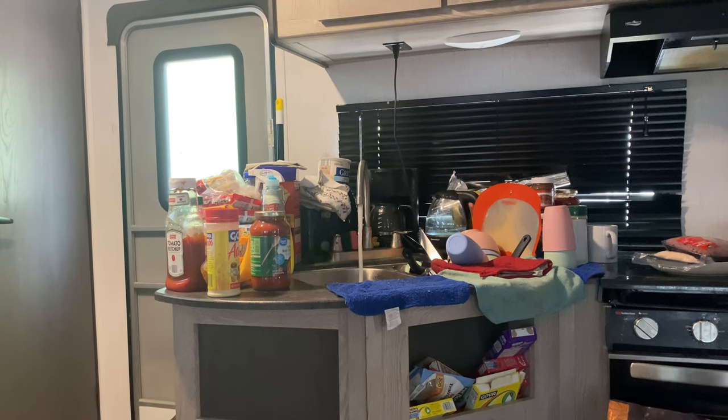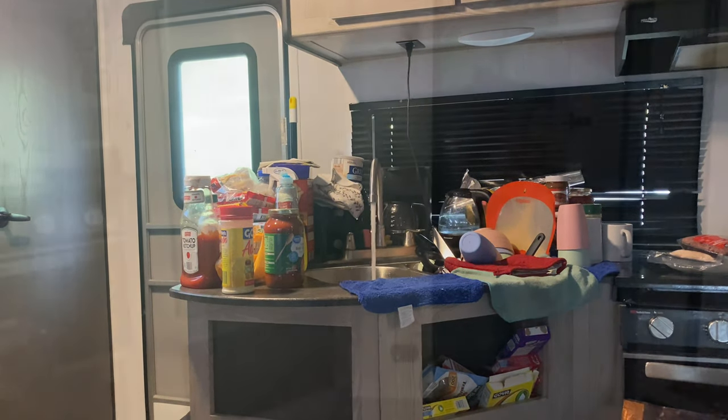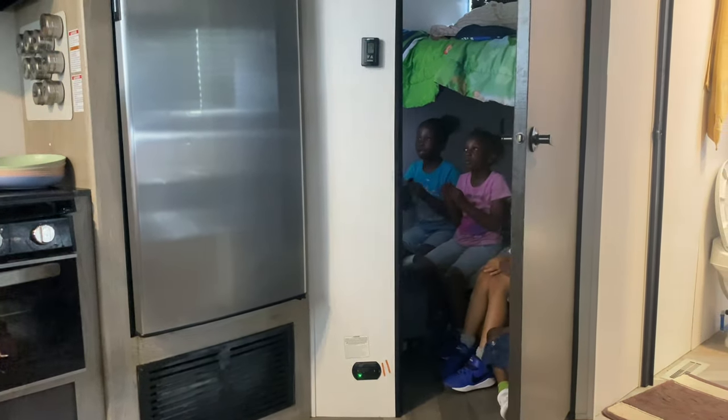You can see the water draining out. Sometimes you'll hear the pump cut on and off; with a good pump you may not hear anything. Another thing I forgot to mention: when you're draining the water from your fresh water tank, you want to turn off your electric water heater so you don't burn out the heating elements when the water gets too low. It took 10 minutes to fill the tank; it'll take maybe double to empty because the pressure coming out through the faucets is much lower than going in.